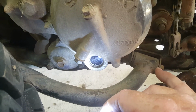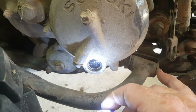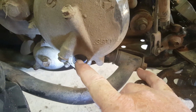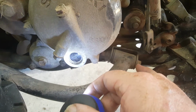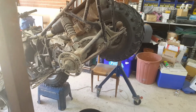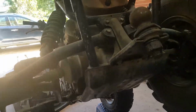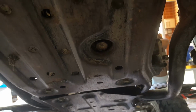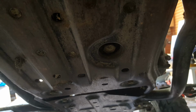What I'm going to do is tip the back of the bike up, get to the oil drain plug and drain a bit out until I can see it in this window. Tip a bit of it back in if it looks clean. We'll go looking for some new oil if it's not. I've tipped the bike up here to give you a shot of where the oil drain plug is. There it is there. It's the 17mm hex head cover, which I will remove.